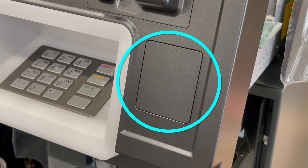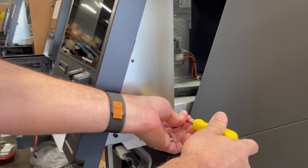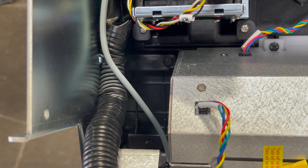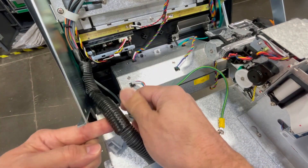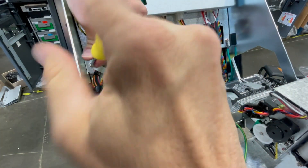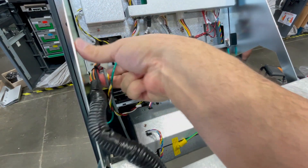Power off the ATM. The first step will be to remove the cutout panel from the front bezel. Remove the screws that allow the front bezel to hinge forward. The cutout plate is located behind this section of the wiring harness. To make this installation easier, we're going to temporarily move the harness. Cut the wire tie on the outside of the bezel bracket, then release the plastic clip that holds the harness to the slide tray. Remove the screw holding the harness tie to the mainboard bracket.